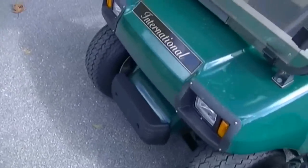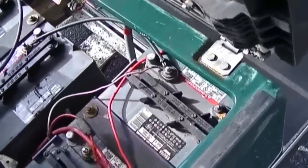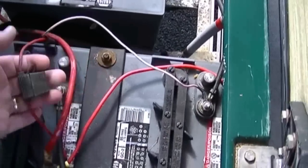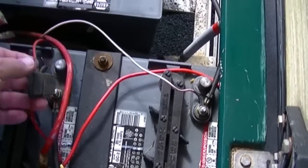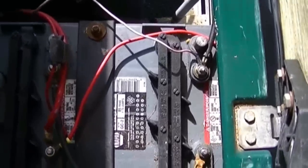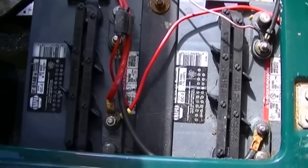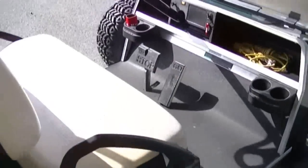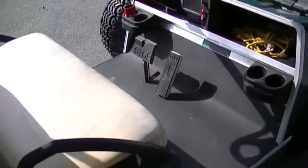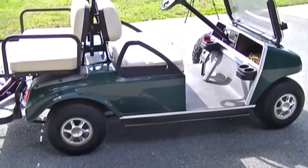It had a mirror and a light kit already on it. Now, something I want to tell you about these light kits — pretty much always they're going to come wired up to a single battery, and quite honestly, that sucks. See, there's the wiring right here — here's your hot wire, here's your neutral wire for the light kit. They were both wired to this single battery, and that's a problem because that's only 8 volts on a 12-volt light kit. So what I've done is wired it in series to the other battery as well — now I'm running 16 volts. They're a little overpowered and very bright. I know some friends who've done it that way and so far they haven't burned their bulbs out, but that is a possibility. I plan on getting a voltage reducer and adding more lights and hooking them up properly, but for now that's my starting point.